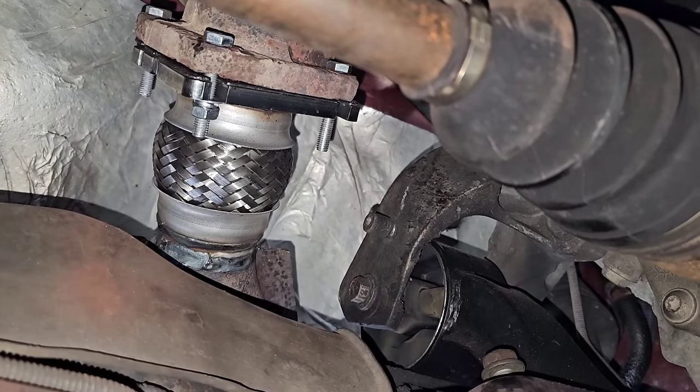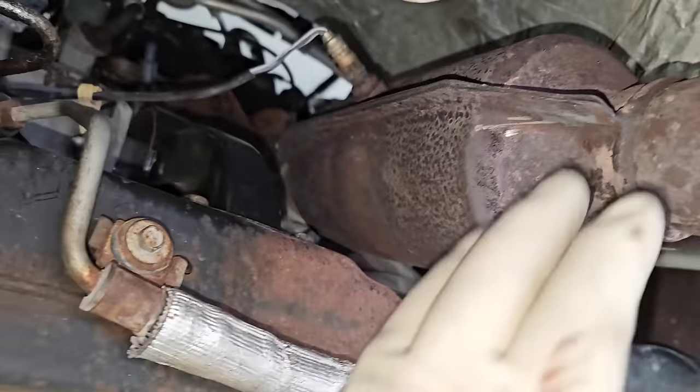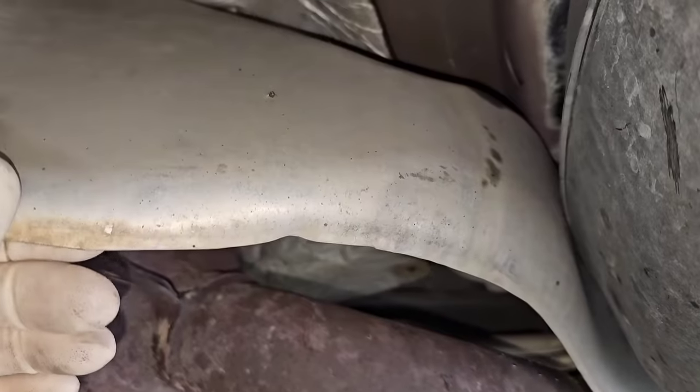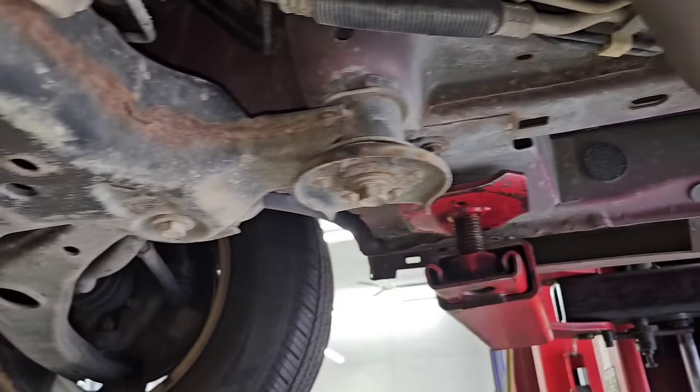Okay, so everything's in place. O2 is connected, bolts are tight, the exhaust itself is tight. I had taken the shield out — it's just one screw up here and one screw up here. Now, I didn't mention earlier the reason for disconnecting the battery when you're welding on a vehicle: if you have everything connected, you can create a surge and ruin stuff — short out computers. I've seen it happen. If you disconnect the battery there's no complete circuit for anything, so the likelihood of shorting something out or burning up a module is very unlikely. That's the reason for disconnecting the battery.